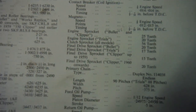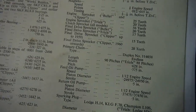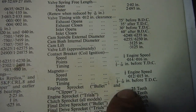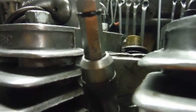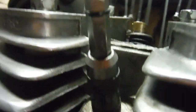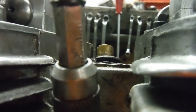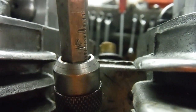The figures given in the Redditch book are seven sixteenths of an inch to half an inch before top dead center. This gauge works in millimeters, so we want about 11mm for seven sixteenths. I'm going to move the engine to top dead center.